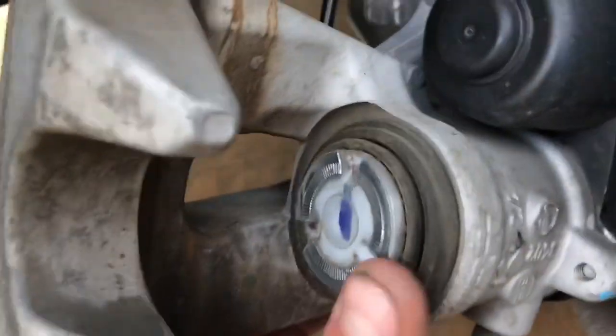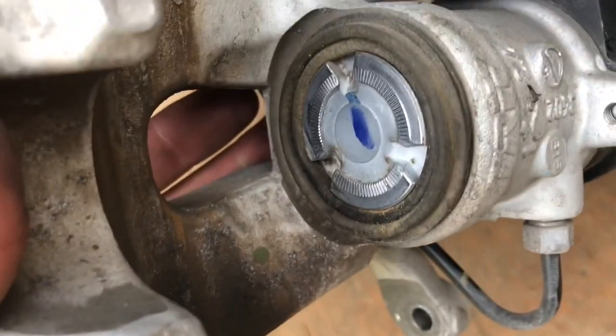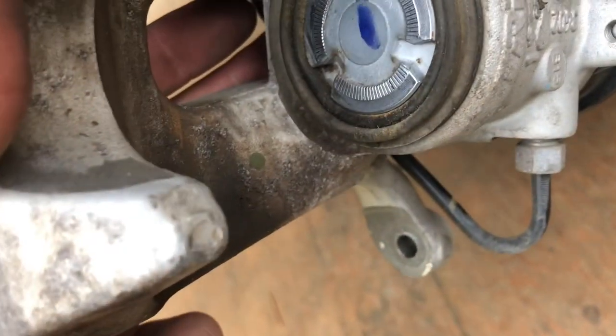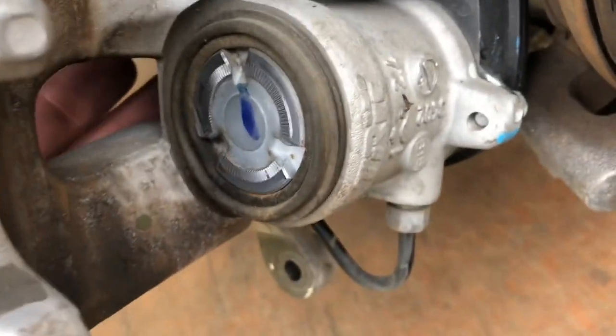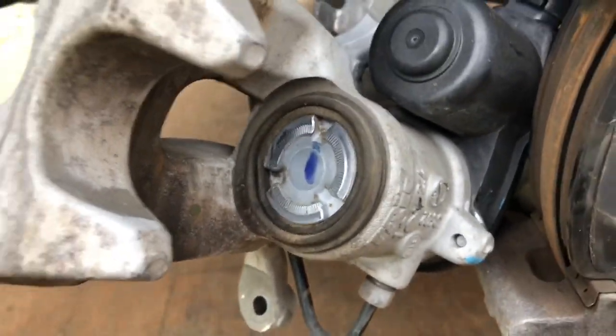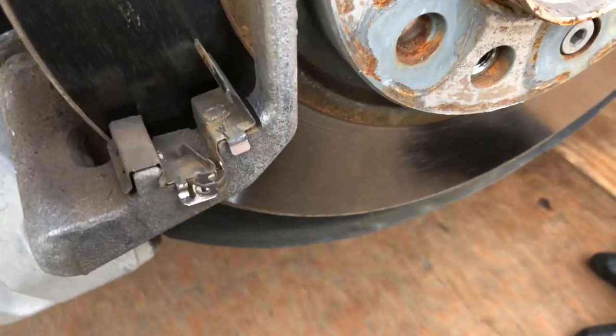The piston is still out, but because we've released the parking brake all you need to do is push. That's just with my hands — not with a C-clamp or anything else. Just take your palm, place it onto the piston itself, wrap your fingers around to this side, and squeeze. That is killer — you save a bunch of time by simply going into that computer and releasing your park brake. To remove the pads, it's the same as the front: pull up on the top side more, it releases, and then pull the bottom out just like that.